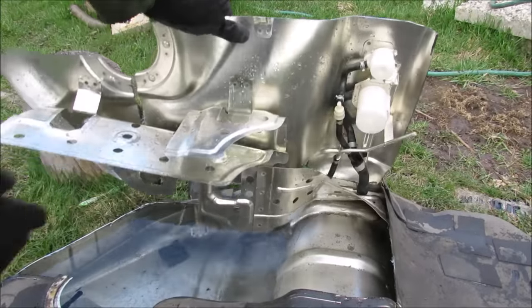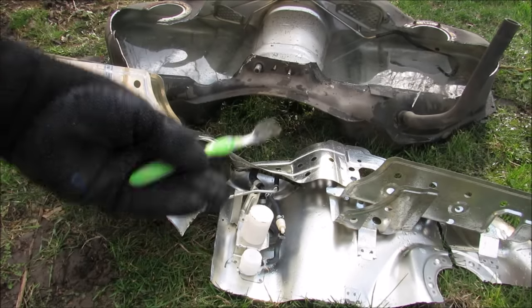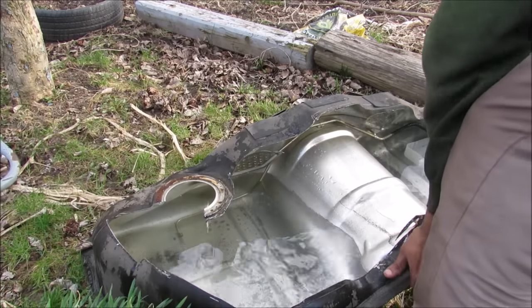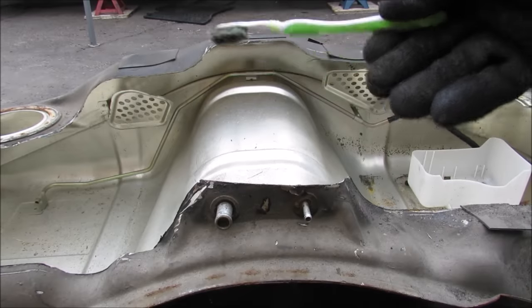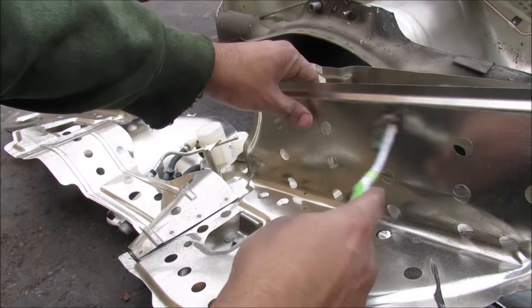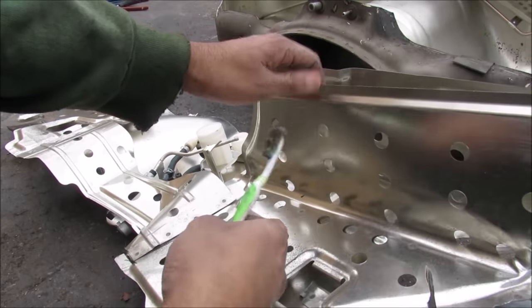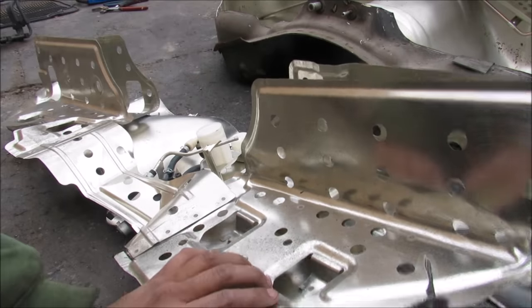If I lift up the whole thing here you can see we have all those baffles in here. With the gas tank cut in half we can take a closer look at what's inside, including all of the valving at the top of the tank. After pouring out all the water, we can see this tank holds about 76 liters of fuel. The fuel tank baffles basically prevent the fuel from sloshing around as the vehicle accelerates and decelerates.